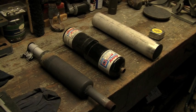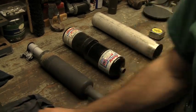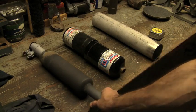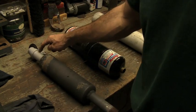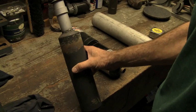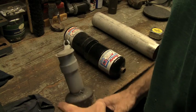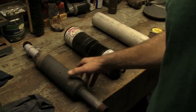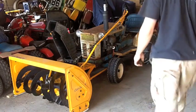Here's a quick recap on the mufflers I've built, and an overview for what I plan on building for the Gilson 16 horse hydrostatic tractor. If you remember, a couple years ago I built this — the first muffler I built for that tractor, at least three years ago now. I used a one-inch nip, a wire feed welder, an old steel fire extinguisher, and inch and three-eighths fence pipe for the flapper. Kind of crude by design, but it worked and I think it had a pretty good sound.